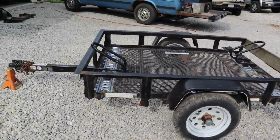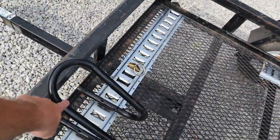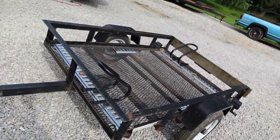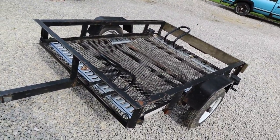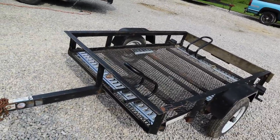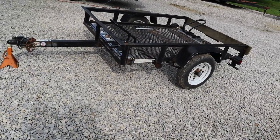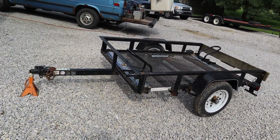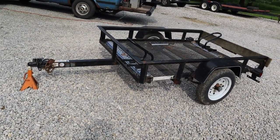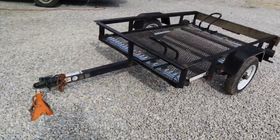Other than that I have no complaints. The tow is really great — just make sure you put some tongue weight on it, otherwise it's going to whip around behind you. I can barely see it behind the 4Runner when it's behind me, other than the handlebars on the bike. But it does ride nice and easy. Get yourself a small trailer, some e-track, buy or make the chocks and you've got yourself a nice little trailer to haul stuff around if you don't own a truck. And it's lightweight — I can pick this thing up on its end and lean it up against a wall, which is probably pretty good for a lot of you guys, or if you have an apartment with a parking space in your parking garage you can put it in the front, lean it up against the wall, and chain it down.